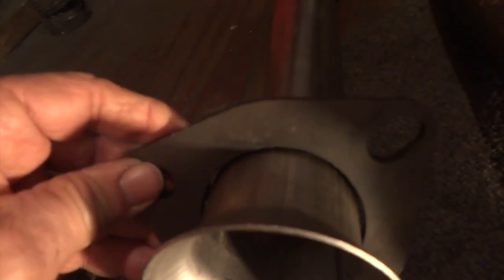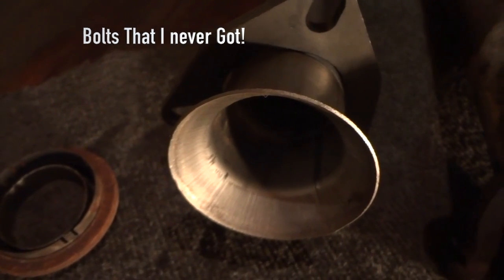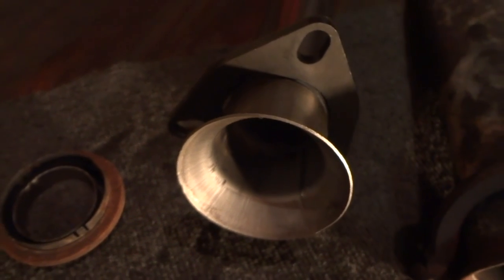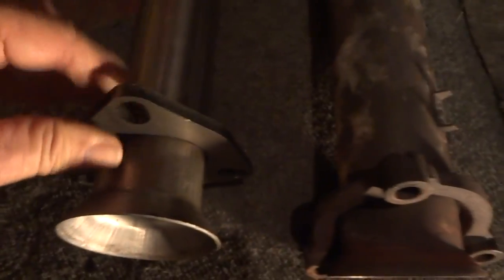I need studs that extend at least another half inch through here, and it's flaring — this one doesn't even have a bevel on the inside. I can see where they probably had some kind of problem because they welded this other piece on here. Maybe they realized this was supposed to be on here and said we'll just put this piece on here and give them some extra long bolts. The downside is you're pretty much going to have to take off your manifold and knock those other ones out. I could try it down here, but if I snap one, I still got to take off the manifold anyway. So I might as well just take the manifold off to begin with. The gasket fits in here okay — it's not a problem, the problem is the design of this flange bracket. There's no point in cutting this perfectly good converter, so my answer is just go ahead and take off the manifold and do it right. But that's the way it goes when you're working on vehicles.